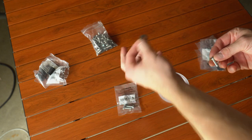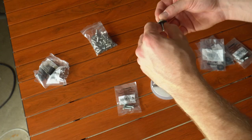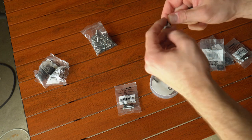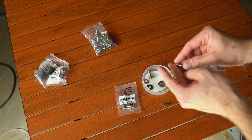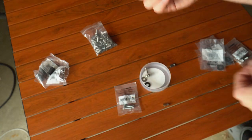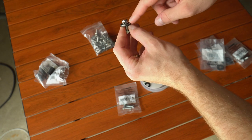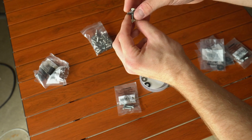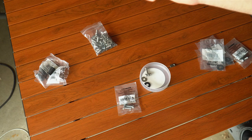The hardware setup is: one flat washer, then a rubber washer to help with waterproofing, and this goes through the case. On the other side of the case we mount one of these T-nuts. We could also use a lock washer. Having a little more shaft on the screw rather than less isn't going to hurt — we just don't want extra threads that would be loose when mounting the case to the roof rack. So the 20mm M6x1 screw with a lock washer, flat washer, and rubber washer threads into the T-channel nut, and all that passes through the plastic case going on the roof.